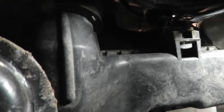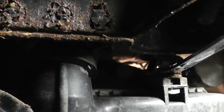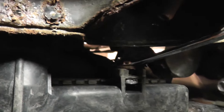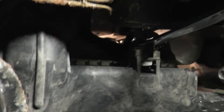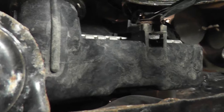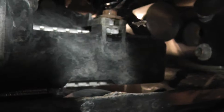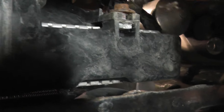You won't be able to get these out with a standard socket wrench — just use a box end wrench. These are 10 millimeter. If they're badly rusted and binding up, just turn them clockwise and then counterclockwise to help break up the rust. If a bolt binds when you're removing it, never force it — that's when you'll strip it or twist the head off. Work it back and forth and if you can, get a little penetrating oil in it.